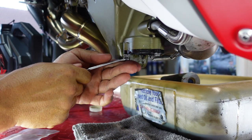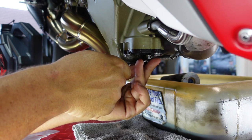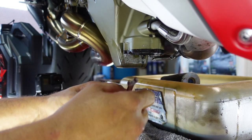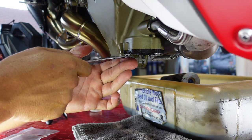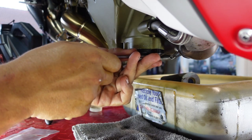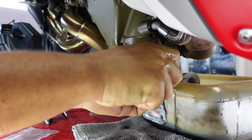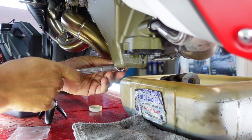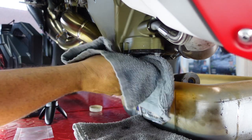I like to get the bolts just hand tight — just snug so they stop right there. My procedure is to go about from 12 o'clock to 11 o'clock — just so they're snug. And that's it. For the drain plug we do the same thing: get it snug and then go one position and leave it. Do a final wipe down when done — get all the oil off so when the bike starts it doesn't smell. And we are all set.